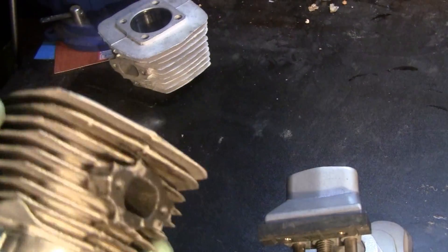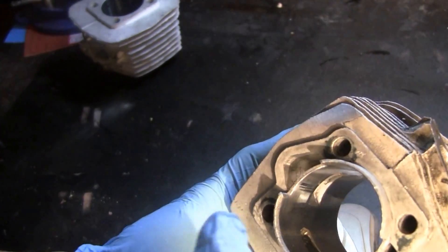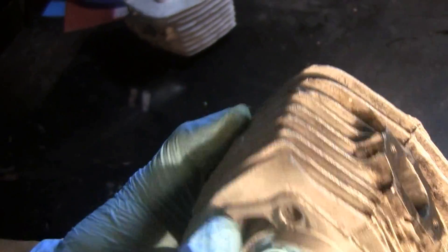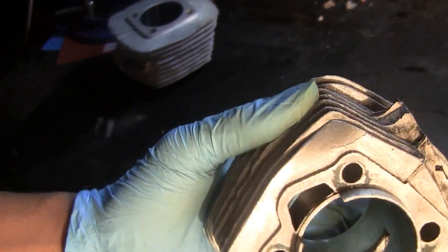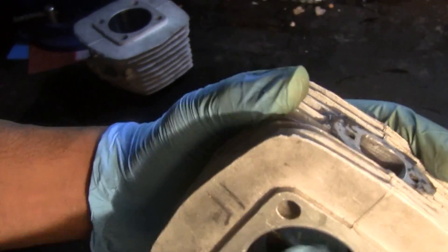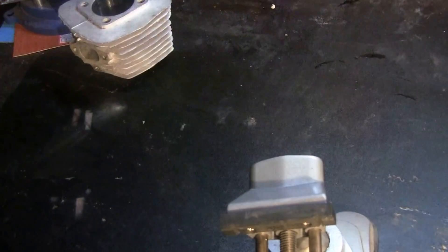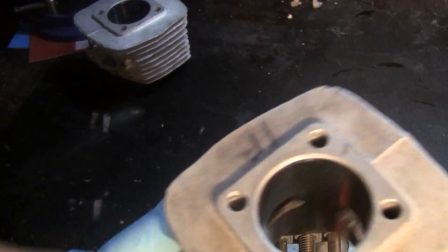In terms of cleanup, it's really imperative that you don't have any metal filings flying around. Clean everything out really well — dunk it in soapy water, use an air assist system to blow everything off, and allow it to dry properly. Upon assembly, it could help to throw a few drops of two-stroke oil inside the combustion chamber and swivel it around — that helps get the piston accustomed to this new jug, because you've done quite a bit at this point.